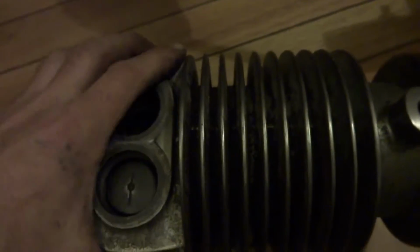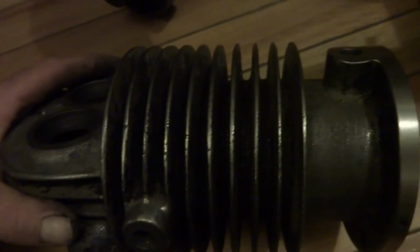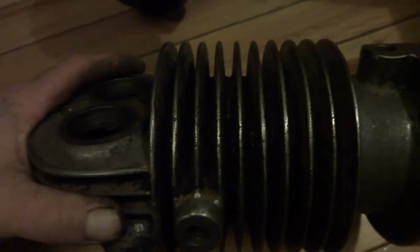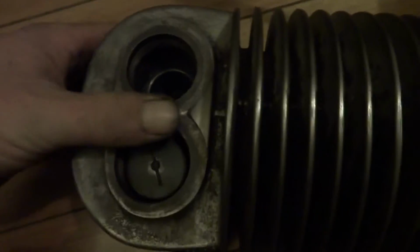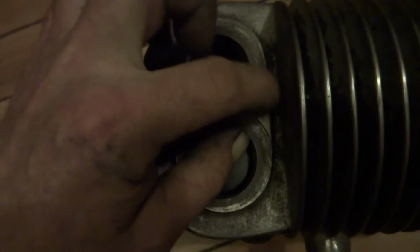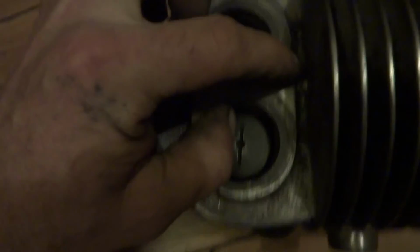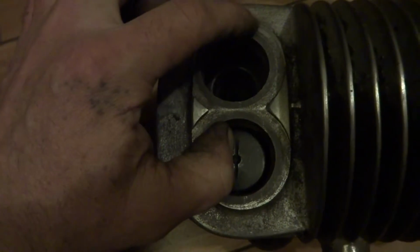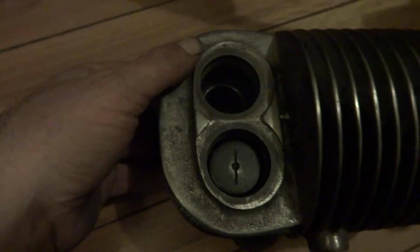But in between the fins, the casting mark across here, the fins were all filled in. I actually took a hacksaw and then snapped those off and cleaned them up with a draw file. And just let the air move past there, and it looks a lot nicer. I call it blending. See that ridge down in there? I took most of it off, and this guy here wrapped way around and then wasn't on this side, so I kind of made them symmetrical, look the same.